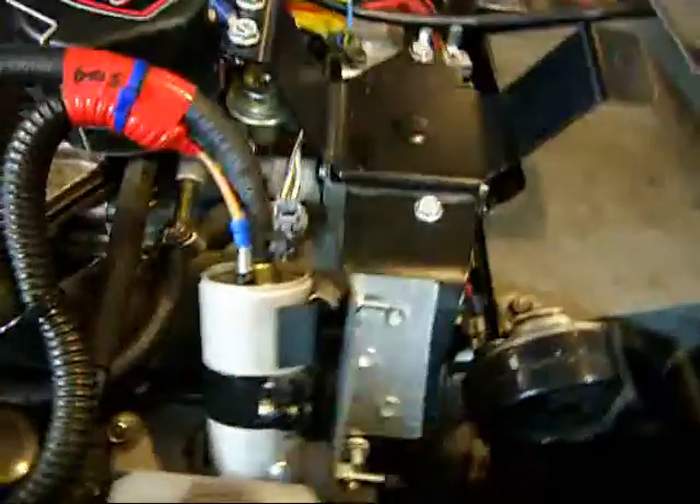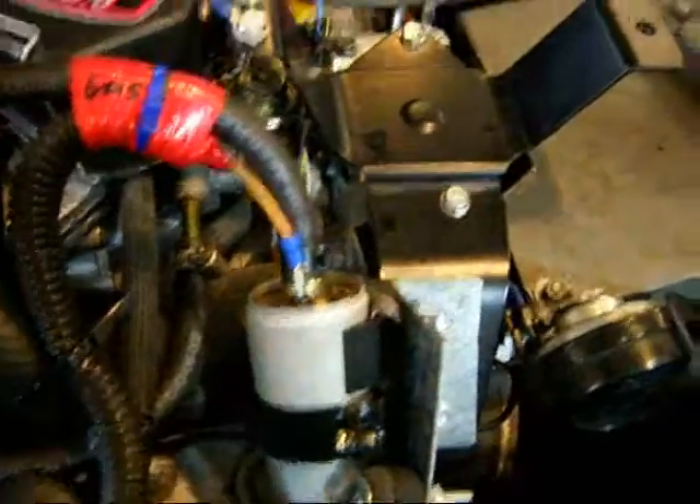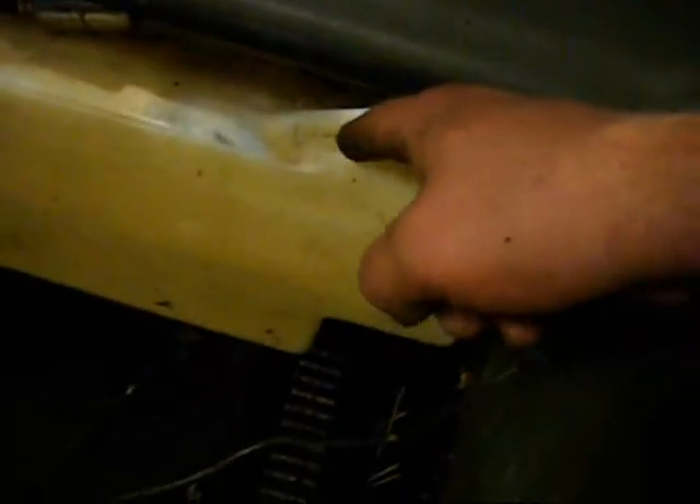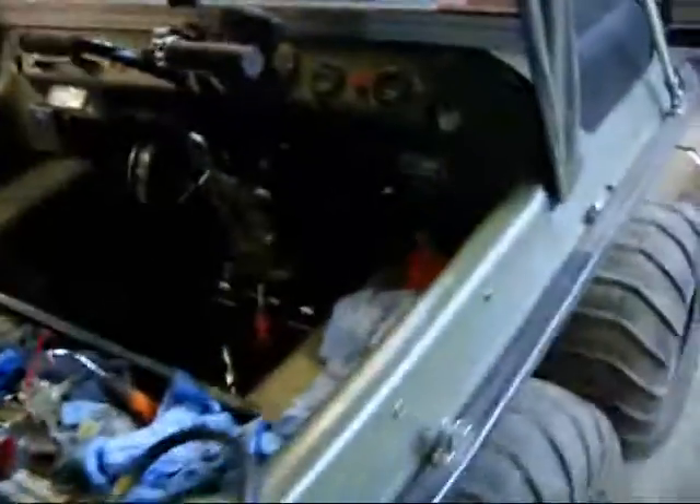Alright, finally got it going. This fuel pump system actually has a return line like a car does. So this return line here — I left it in there, it was the original fuel line, but I replaced it with a 5/16. So I used it to temporarily just go back to the tank, but I got to put in a little fitting back here and let the return line go inside there too for the fuel pump, fuel injection system.